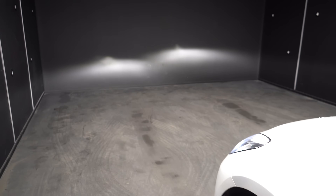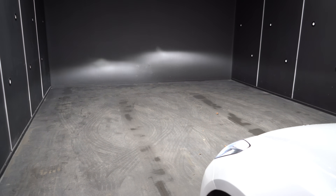We can see here that headlight is pretty static, so we need to adjust that one for sure. Like this it's too level — in fact it's pointing up a little bit — and therefore it's going to be blinding other drivers.